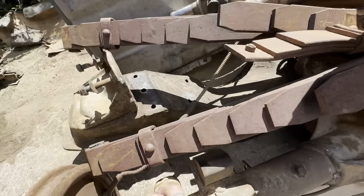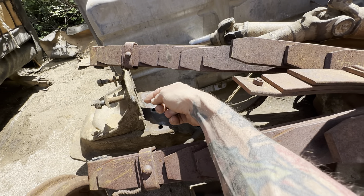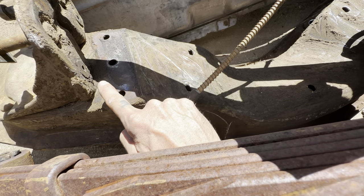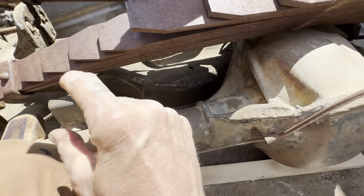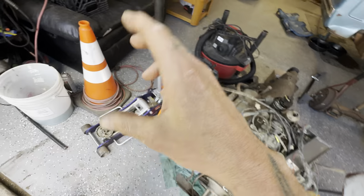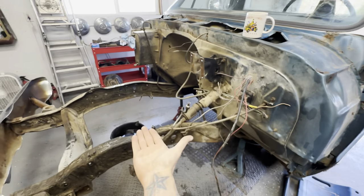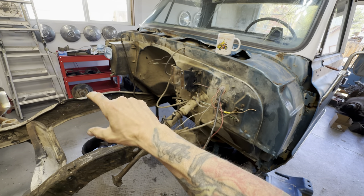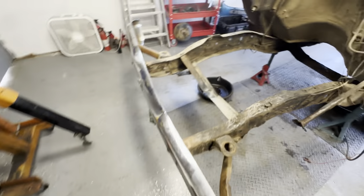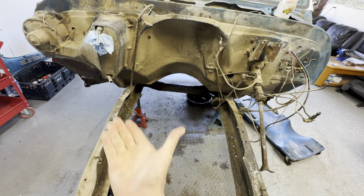Look it up. That's where it mounts to the bottom of the frame, and bolts go through it, and there's holes in the side of the frame the bolts go through. So you basically just cut straight down, then over, and you remove a two-inch strip all the way to the other side. Do the same thing on the back, then drop the whole thing down, making it two inches shorter — which raises the bottom of it because it's still going to bolt to the frame. The part that bolts to the frame stays there, you cut two inches around it, move the whole cross member up to fill the gap, and weld it back in. You do it on the floor, obviously. Everything's two inches higher and you gotta redrill some holes because the outer holes are going to be up higher two inches.